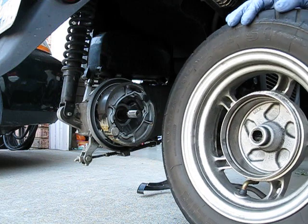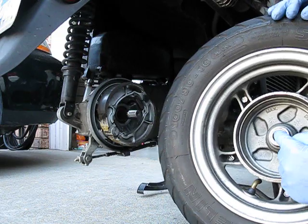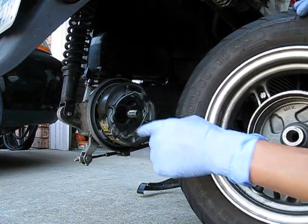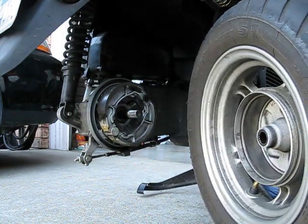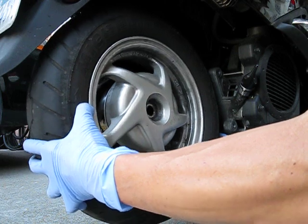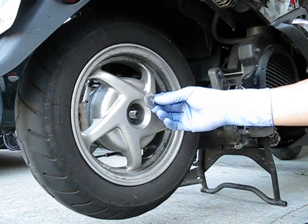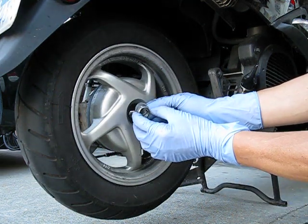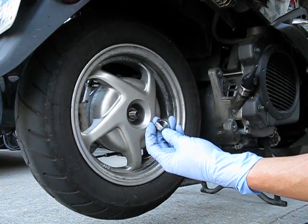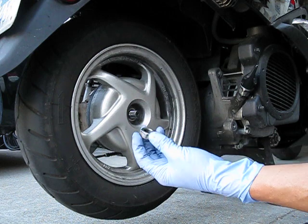When you put this back in, be aware that this wheel's interface is splined along with the axle — it's splined. So make sure you put it in properly, nice and square. Put that in, put your washer in, put your nut in. I can't remember exactly what the torque specification on this is, but I think it's about 80 foot-pounds, somewhere around there, possibly a little bit more.